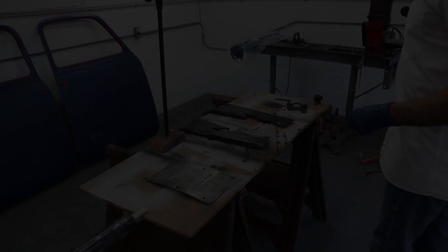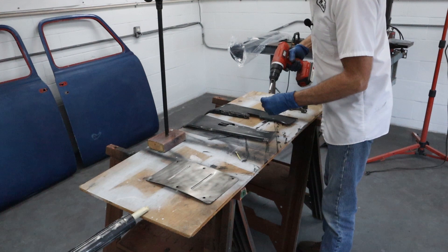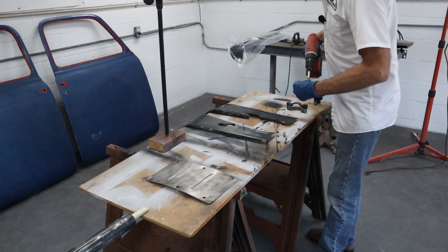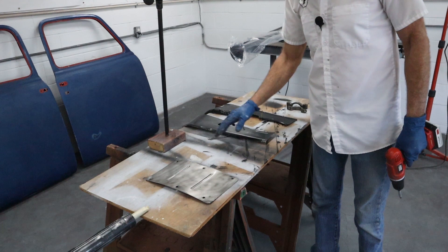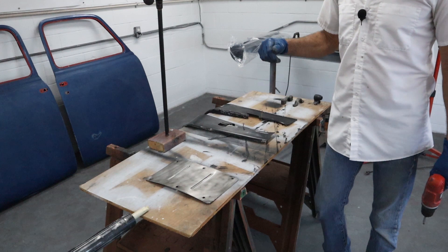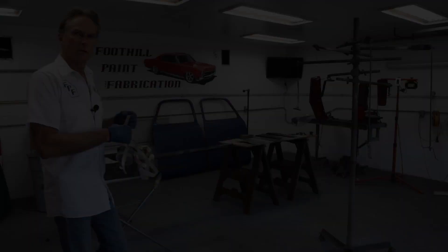While blowing off, these two pieces kept trying to fly off. There are some holes in them, so the good thing about using plywood is I'm going to put just a screw through there so they don't fall off, and then I can paint all the way around that hole no problem. This one should stay flat and will be fine. These other pieces are a little too heavy to be blowing around, so we'll put them over by the other parts so I can hit them all at the same time. We're about ready to go. The steering column — all I had to do was protect the end and the gearbox end, and then I'll just spray all the way around it. So let's load the gun and get spraying.